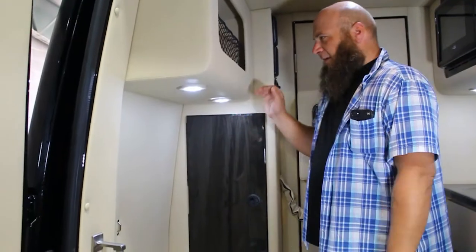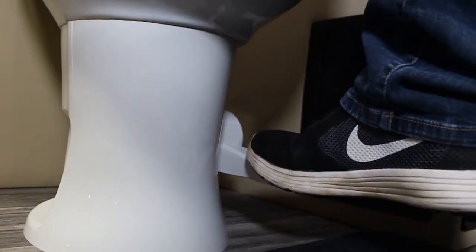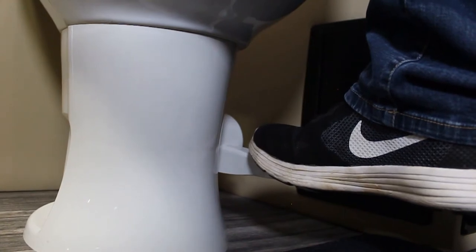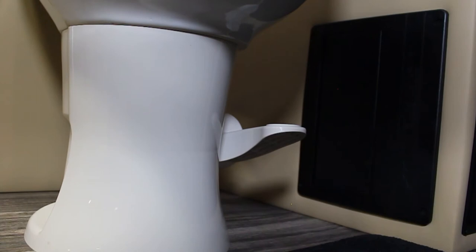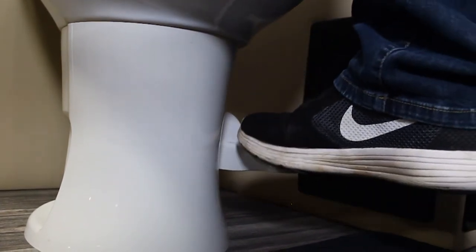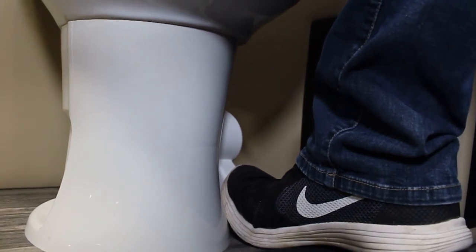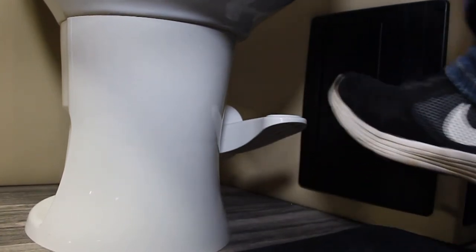Let's talk about the toilet and how to operate it. With the water pump turned on, take the foot valve on the front and push it halfway down — that's going to begin to add water to the bowl. Add the appropriate amount of water for whatever you're planning on doing, then let your foot off the valve. Do what you came to do, and when you're finished, push the valve all the way down to the ground. That opens the trap on the bottom and water will continue to run down the sides. Once the bowl is clear, let your foot off the valve — it's reset and ready for the next use.